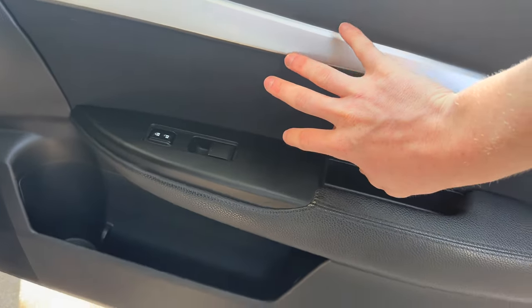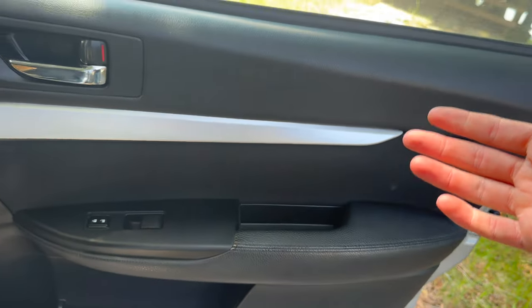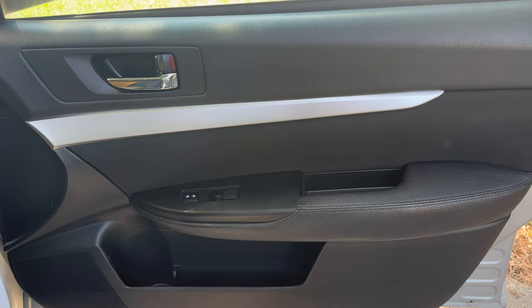What I've got here is some sound deadening material — it's just an adhesive mat. What I'm gonna do is take off the side panel of my door, stick it on the inside of the skin, and hopefully that should make it sound more like a car door and less like you're smacking a piece of sheet metal.